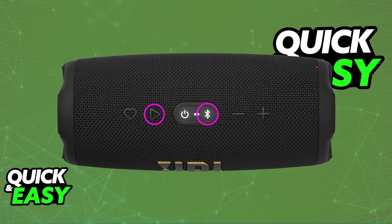You will have to hold them for 10 seconds. So while the JBL speaker is connected to your PC with a USB cable, press and hold the play button and the Bluetooth button for 10 seconds. It can take a while, but eventually it is going to start blinking rapidly on the LEDs, which means that it is now in service mode.